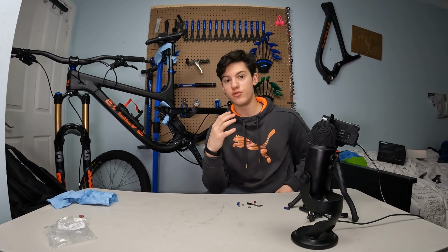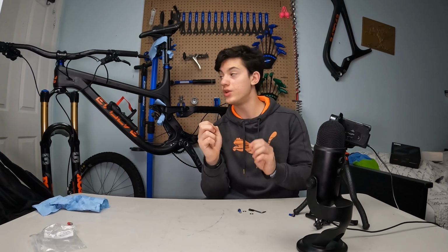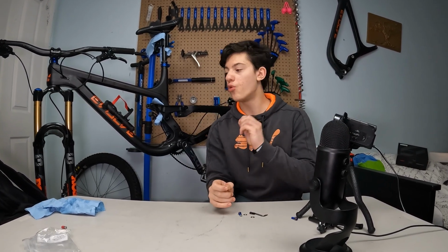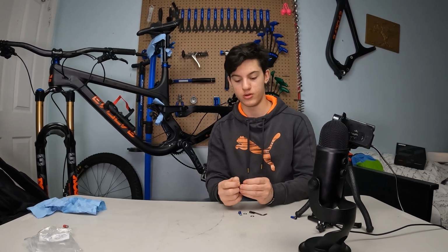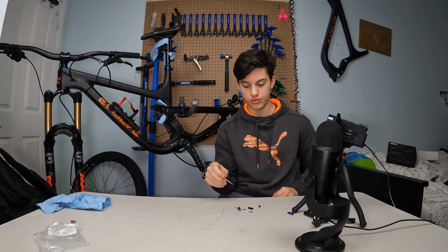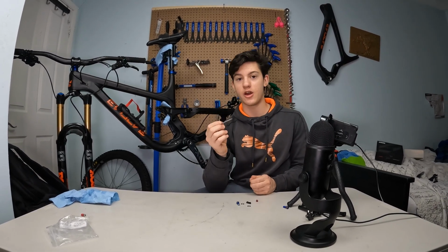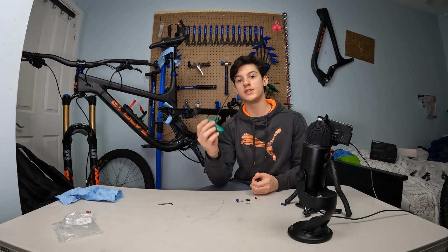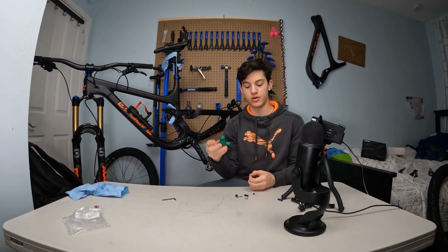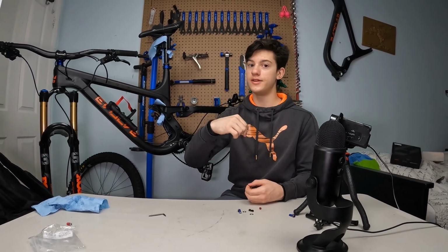When you receive your new brake, you have an additional olive and barb which we are gonna use, because you don't want to reuse your old one. You never want to reuse your old one. They even give you a tool to screw those in, because many people don't have this kind of tool. This is a T8 Torx wrench. In my case I have it, so I'm gonna use this one. And all the tools that are shown in this video are gonna be linked down in the description.